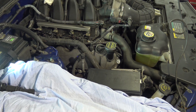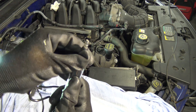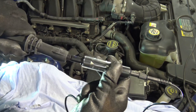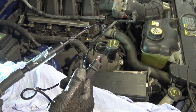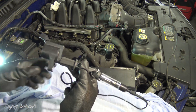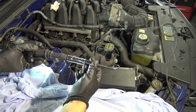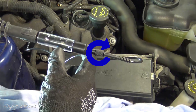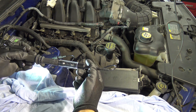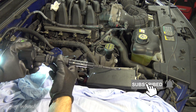To test this coil, I use an ignition coil tester — I put a link below in the description. On one side, it's shaped like the top of a spark plug, so I plug it directly into the ignition coil. The wire on the other side should be connected to the car frame, and I will be able to observe the sparks in this window. The engine must be running with the coil connected to the primary. I can adjust the length of the spark by turning the ground connector. The standard spark length for ignition coils is approximately 2 centimeters — much longer than the spark from a spark plug, because the gas pressure is much higher in the cylinder than in the tester. I'll start with a spark length of 1 centimeter.